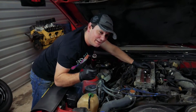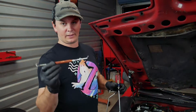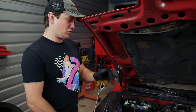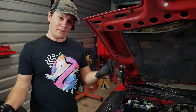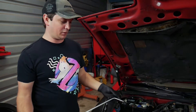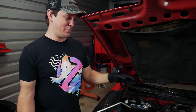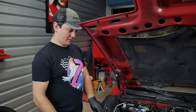I'm going to get in there with a screwdriver or a pick — something pretty thin, whatever you've got at home lying around — and break all that nastiness up. Once you break up enough of it, try to get either a vacuum cleaner or, if you have an air compressor, hit it with a bunch of air and try to get all that stuff to come up. What I don't want is all that stuff to fall into the hole when I pull the spark plug out, because that goes directly into the engine. We'll blow all the dust out the best we can and minimize how much goes into the engine.